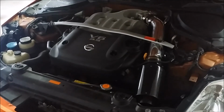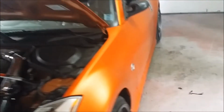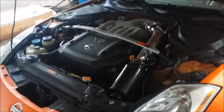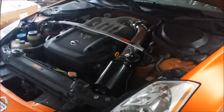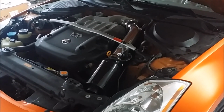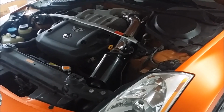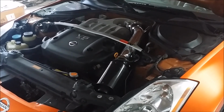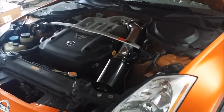With a supercharger, I don't need to worry about exhaust gases or anything like that. It's all belt driven. After doing my research, the main issue we're going to have is the bottom end, boost wise. It seems that as soon as you get anything above 6-7 pounds of boost on the stock bottom end, you start running into issues, which is fine. I mean, 7 psi in these things is pushing 500 horsepower. But I don't want to get to that stage, so your boost control has to be absolutely spot on. That's why I upgraded external wastegates and all this other stuff, and blow-off valves are very important. If you're going supercharger, you don't have a lot of these issues. You just have to worry about the quality of the install and the quality of the supercharger.